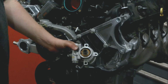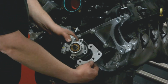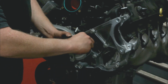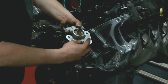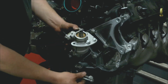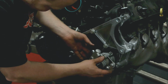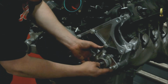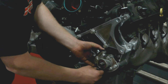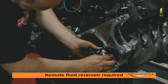Now we have our Type 2 power steering pump and the bracket. Drop the bracket on like this. We take one of these M8s. The other short M8 goes here. We have two longer M8s. They drop in there. And then this assembly just drops into this bracket. Start one. Outside short bolt works good. And then we run those in.